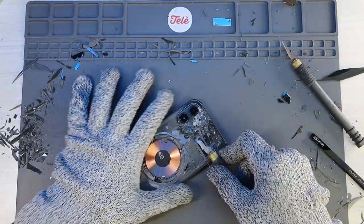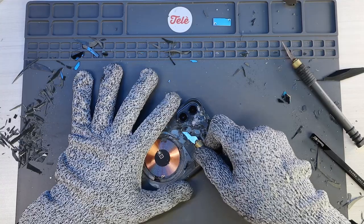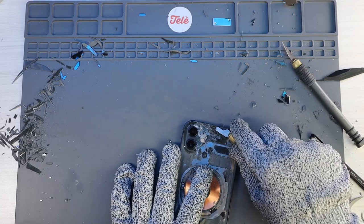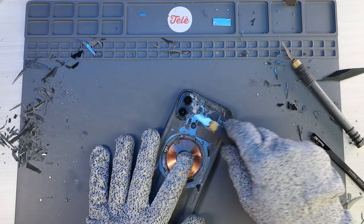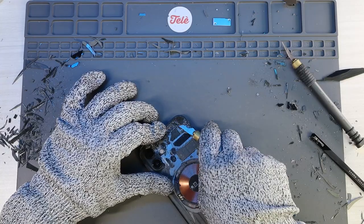As this is my first iPhone 12 back glass, it looks like they changed a few things, but that's no problem — I'll get it done. I don't really have any access from this side, so I'm just going to grab the glass right here, hold it down, and break it off. There we go — that's one way to do it. They said it's not repairable — challenge accepted. I'm being so careful because it looks like all these MagSafe components are connected, and there might be a wire running through all of them. I don't want to risk pulling up and damaging a component, so I just have to go really slow.